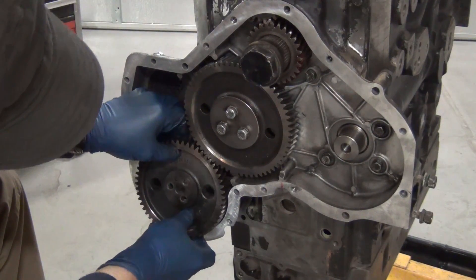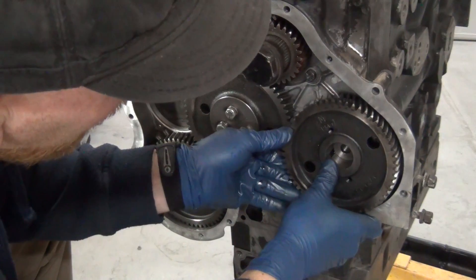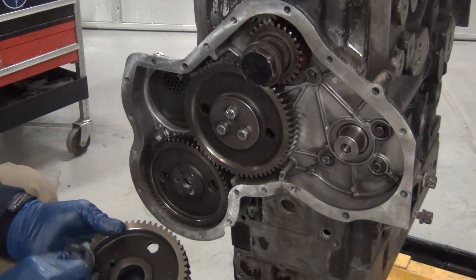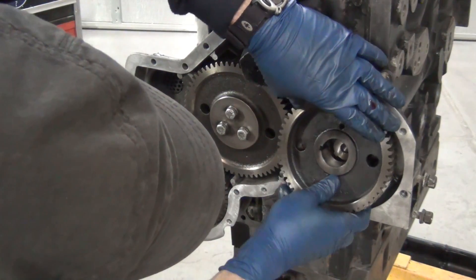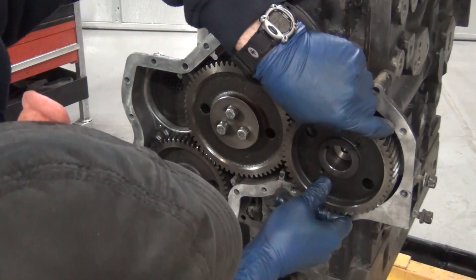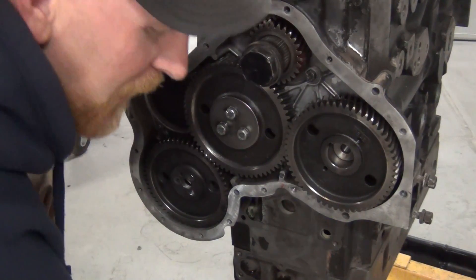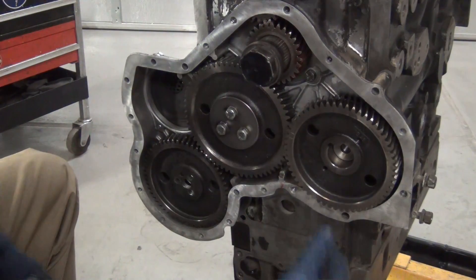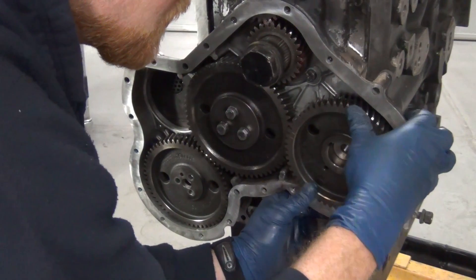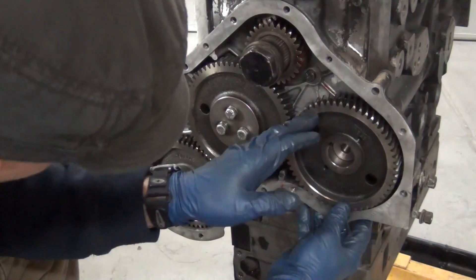This one is for the fuel pump or the distributor pump assembly. This one's for the camshaft. I'm just going to line that up. Unfortunately I didn't make a mark for the camshaft on the timing cover — I figured it would all work out and of course it isn't. The good news is that turns by hand and we can bring that together anyway. I need to get that keyway to line up about right here and then the rest should fall into place. If I hit the camshaft and knock on it, it'll impact the lifters and could knock the plug out of the back — the Welch plug. There's freeze plugs and Welch plugs at the end of the camshaft. It's a hole that is plugged because it's only used for machining. This is so much easier than you'd think.